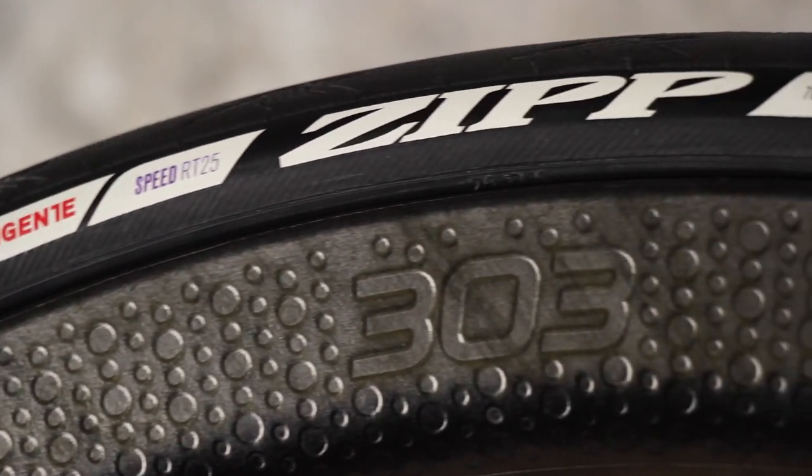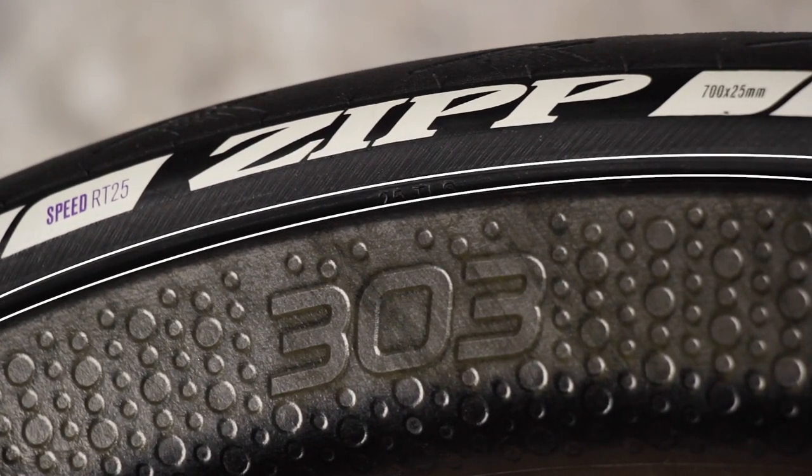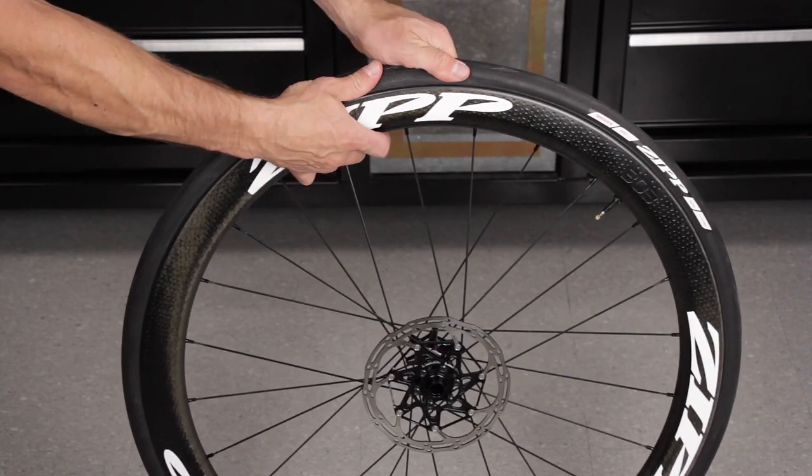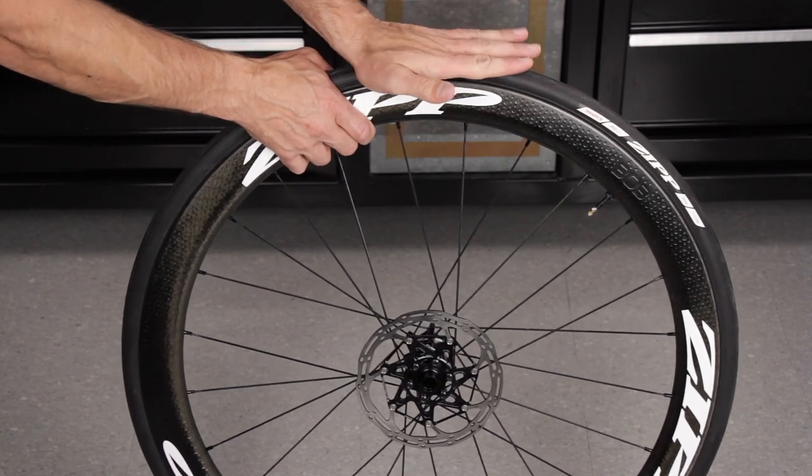Check the seating of the tire by examining the line above the rim flange. The line should be evenly spaced from the rim on both sides of the tire over its entire circumference. If it is not, release some air pressure and adjust the tire by hand. Then reinflate to the desired amount and check again.